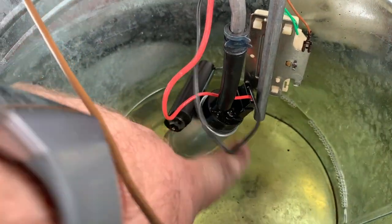Everything is now connected back up in the bay. I've prepared the hard lines for the return both in the bay and in the cockpit area of the car. Hopefully now it's not going to leak anywhere, so time to pressure test the lines — third time's the charm, right? Good news is no leaks! I heard the regulator pressurize twice and then it fully blew the pump off the feed — squirted through a good six feet. But that's good news — I just need to secure the pump onto the hanger properly, which I think is just a missing jubilee clip. A couple of pre-flight checks and I'm going to try for a first start.